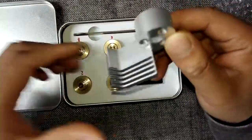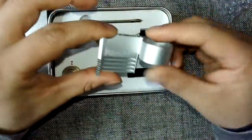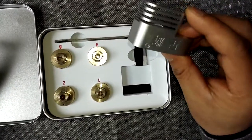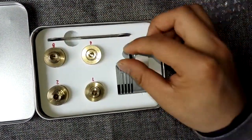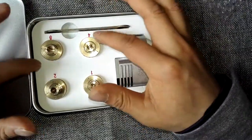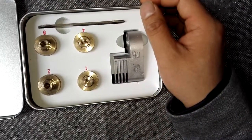This is the metal headcomb. It supports 1 to 8 heads, meaning 1 to 4 platters. It's very cost-effective and all-in-one. There are 4 pillars, and each pillar is marked with 1, 2, 4, and 8. Different pillars are used for different drives with different head counts.